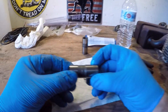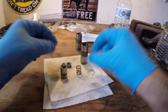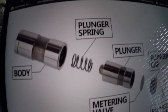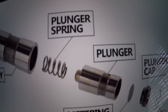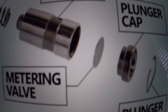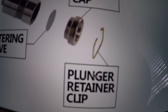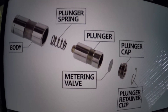So that is what a Kohler hydraulic lifter looks like — rather uneventful, but these are the parts. I googled Kohler hydraulic lifter and what came up was Summit Racing — I've ordered a number of parts from Summit for my ATV. Looking at the body, the plunger spring which I showed everybody, the inner core is the plunger, and that thing that fell on the ground with four holes on it — that's the metering valve. Then the only thing left is the plunger cap, which I took off, and the clip. Really nothing that appears to be rebuildable.